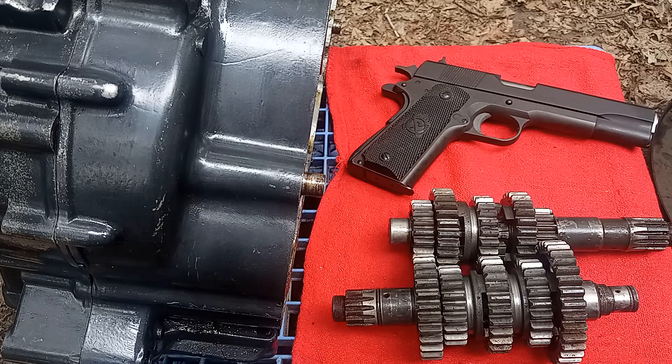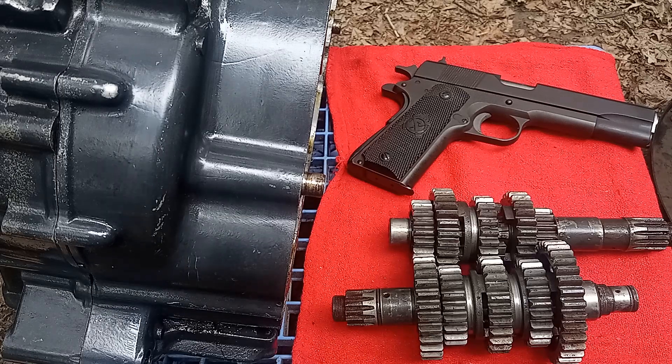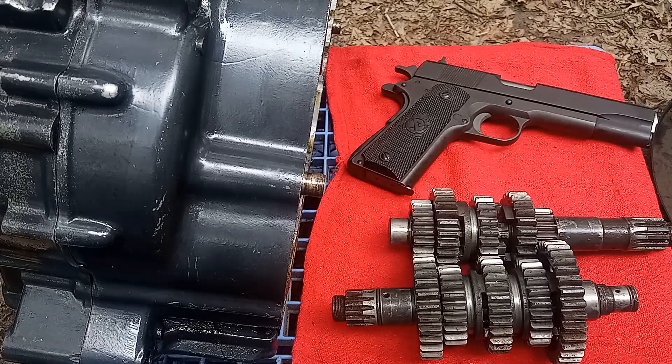When I had that apart I put on this dry film — you know, like everything now people are using Cerakote. I think it was like a pre-runner to that. But this particular paint that went on the cases was designed so that normally if you paint something it raises the temperature, but this stuff is designed to actually lower the temperature more so than bare metal — it'll pull the heat out of it.